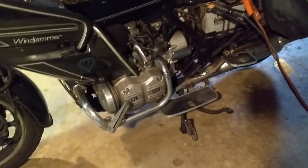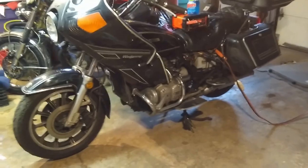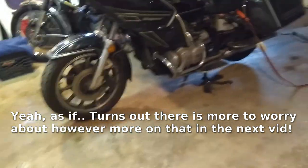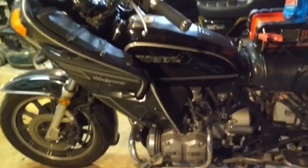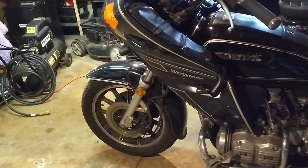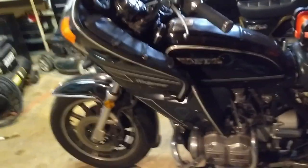To get the plugs off I have to take the lower fairing off — just a few screws. The two things that worry me most are the motor — making sure it's not seized — and the alternator — making sure it charges. Everything else checks out fine. I did look at the rear brake disc and it needs to be replaced pretty badly. There's also the consideration that pressing either the foot brake or the hand brake applies brakes to both front and back simultaneously, so bleeding the brakes will be a bit of a challenge. Fortunately, I have a Haynes manual for this bike that came with it.